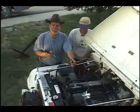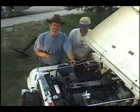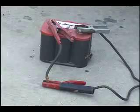The final step is to install the throttle control cable. You just shorten it to the length that you need, mount the bracket, and you're ready to go. The DC welder comfortably welds one-eighth inch rod at a 100% duty cycle, or fully charges a battery in just under five minutes.